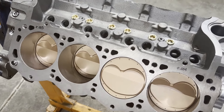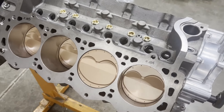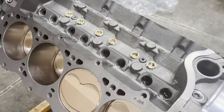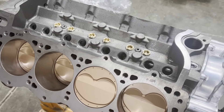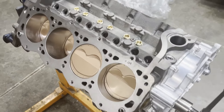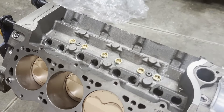A lot of the time we're wide open throttle, and we run a little bit of compression — this one's going to be about 11.5 to 1. So you want to keep everything cool in the chamber and on top of the piston. That makes the engine happy, keeps the piston cool, so we had the tops coated. This is a dry sump engine — that's why I've got the lifter valley plugged up.